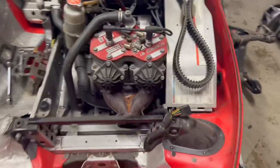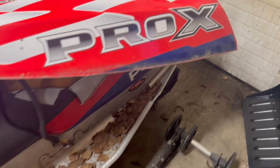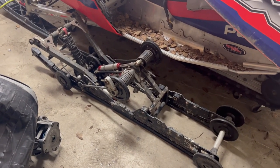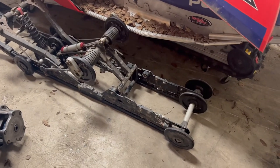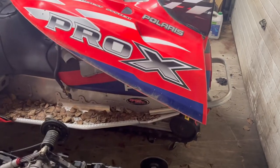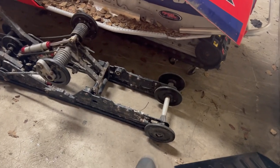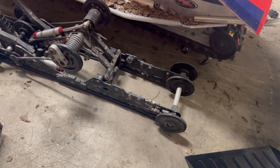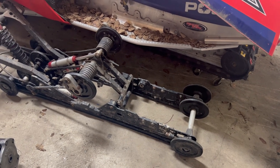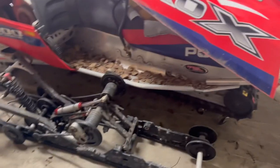Went ahead and pulled the chain case apart so I can swap the track and keep the ice track somewhat decent. Pulled the rear skid out of one of my Pro X2s. The reason I picked this one is it's a 121 skid with rail extensions, where my other Pro X2 has full-length 136 rails. I didn't really want to long-track this, so I'm going to take the rail extensions off, cut the hyfax down, put the adjusters back on the 121 rails, and just go full send on it.